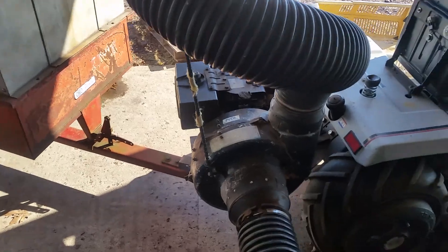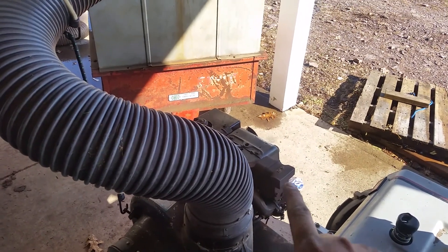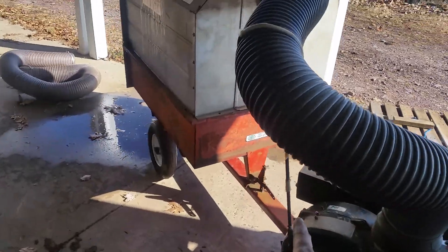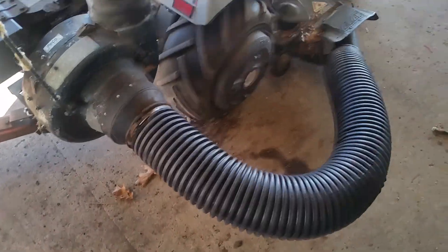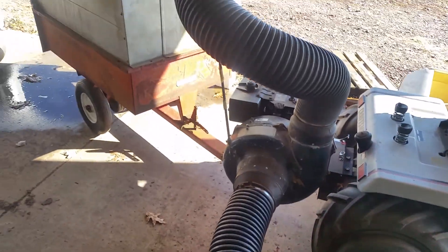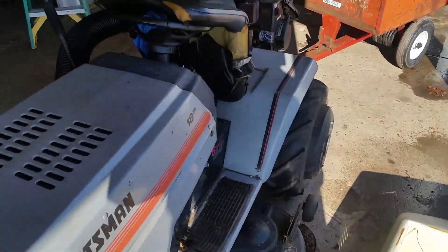This Tecumseh has no problem running this thing — it doesn't burn any oil. I stuck a push mower air filter on it just to keep the dust out, and I put a deflector on the exhaust to deflect it off to the side, which actually works really nice. The bungee cord here is to keep the hose off to the side so it doesn't smack me as I'm driving. I can unpin that from the deck and pull it off if I have to clean it, so it works really nice. Very rarely do I have any plugging issues unless I suck up too many leaves too quick.